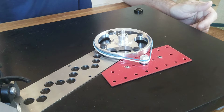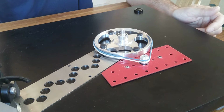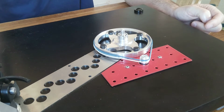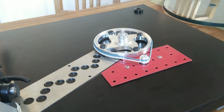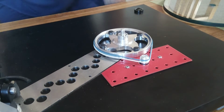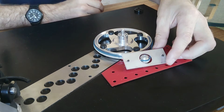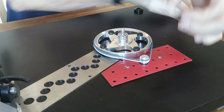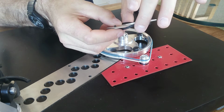motor, but it's actually routed all the way through the chipboard, and it's only this resin layer that is used to suspend the motor from two bolt points. So you had your two bolt points, you had a metal plate, which I'll get. So you had a metal plate on the underside. You can see the screws there, and then that had a rubber belt on which the motor would be suspended.